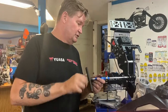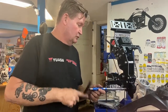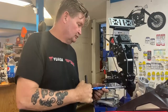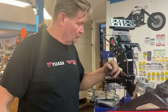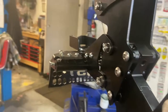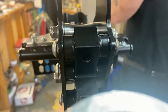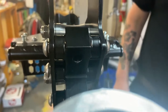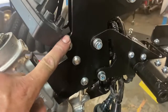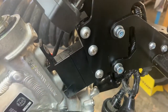This tower does not comply with the latest FIM breakaway rules — to do that, we would probably have to have nylon bolts up against the frame. You can see all the bolts have a space between them and the tower, and they're all about the same, which tells me they were not threaded all the way through. So the whole tower has to come off — I'll run a true tap through the whole thing. Update: threaded this guy all the way through; these ones you can't, so these ones are actually shorter bolts for now with plain washers until we get the Nord locks in place.